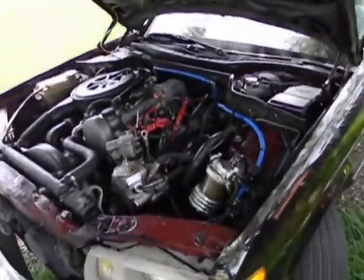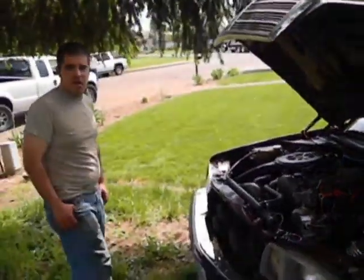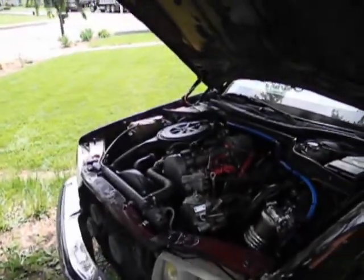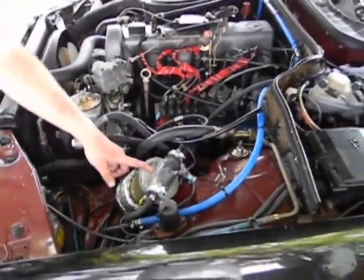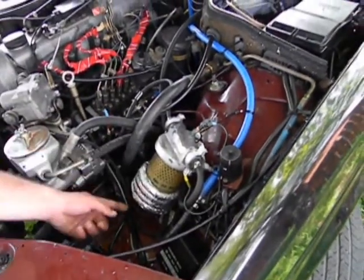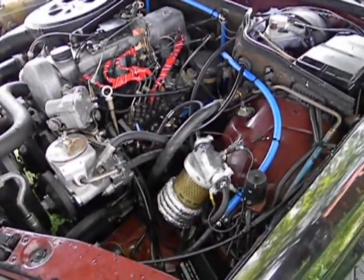All right, so this is a finished product — we did the conversion on this. We pretty much replaced the fuel filter here to be able to get more fuel through, get it warmed up, and be able to see if there was any water separating into it so we could drain it off. It's just a standard filter from a diesel transfer tank.